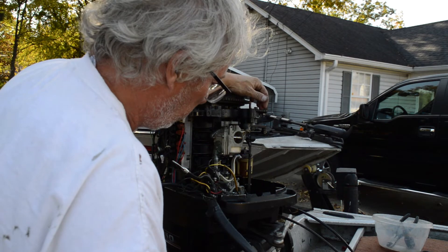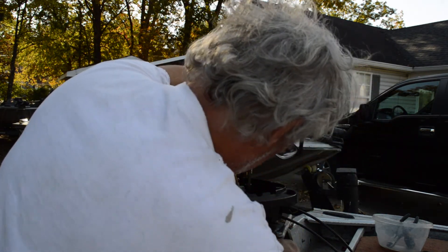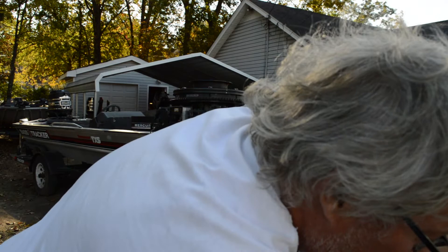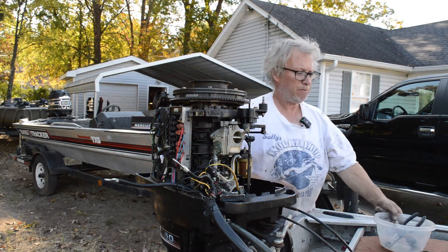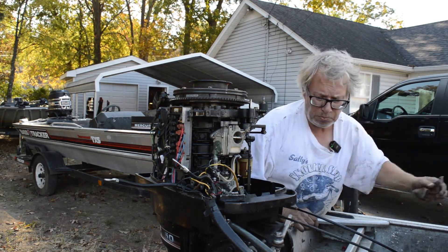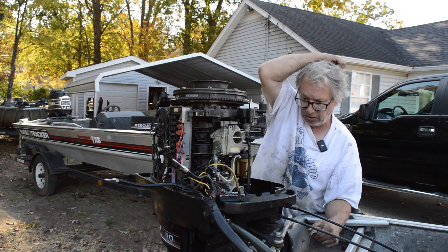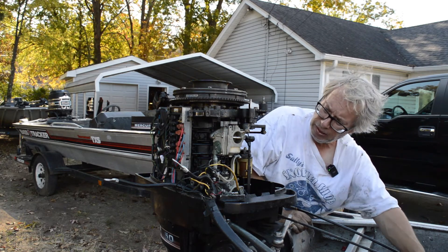Okay, here's the aftermath of the repair. The fuel bowl on the bottom seemed to have water in it and there was gas in the float, so the float wasn't working right. Now it's kind of the moment of truth. I've replaced the fuel lines and put tie wraps on them. Now is the time to hook up our fuel and see if we got any leaks — see if we have any fuel coming out of our jet. Right above the jet is our air-fuel needle valve.